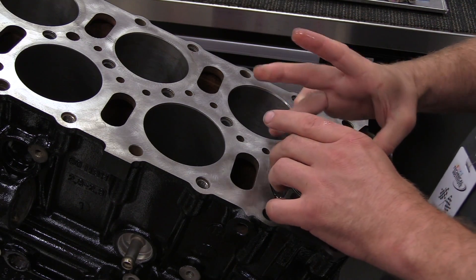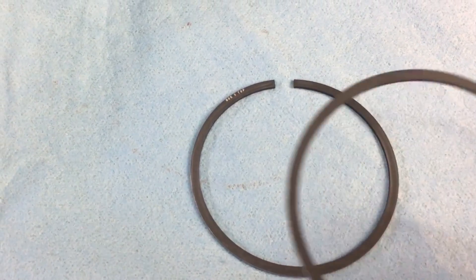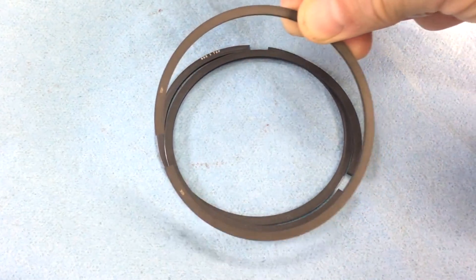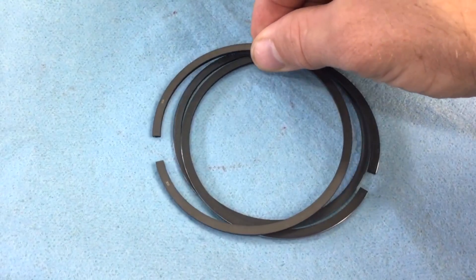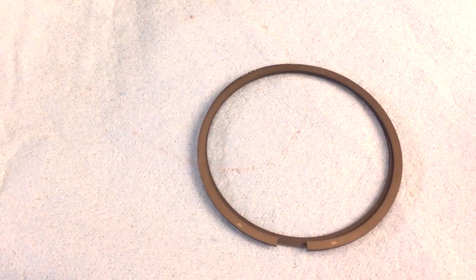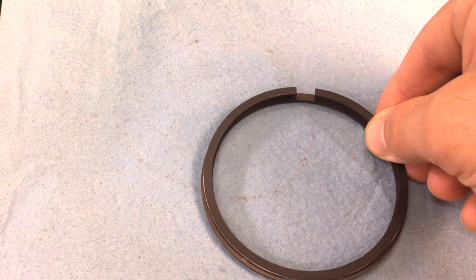As we round home, it's time to put the piston in the cylinder. Before installing the piston, we want to make sure that the rings are clocked properly. The repair manual for this engine says the ring gaps should be 120 degrees apart — so officially, that's what we'll recommend. I have gotten pro tips of doing them 180, 0, and 180, which means one gap at 6 o'clock, one at 12 o'clock, and the other at 6 o'clock. Mr. Wolf, the engine builder that helped me through this process, mentioned that's what they do for race engines.